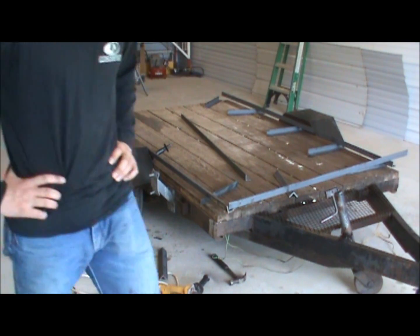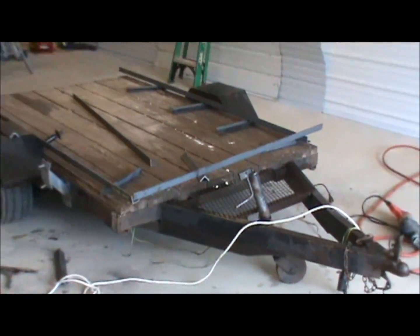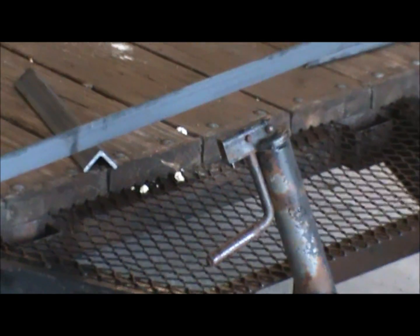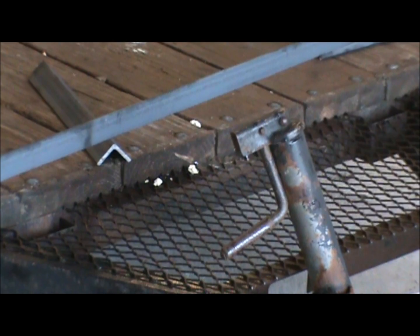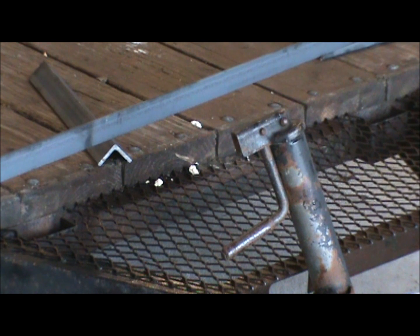Look at what I've done in just a couple of hours — it shouldn't take too long. Right here on the front of the trailer, you can see there's expanded metal with a piece of angle iron. In order to get a good solid mount, I'm going to have to use the Sawzall and cut that out. This would be a perfect application for a torch, which I don't have. So I'm going to bust out the little Milwaukee Sawzall, put the metal blade on it, and cut that back. That angle iron right there is real thin, so I'm going to be able to mount this to the frame and run it all the way to the bottom just like the rest of it.